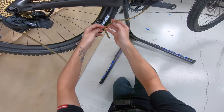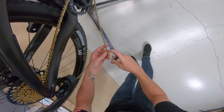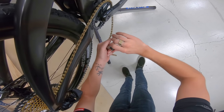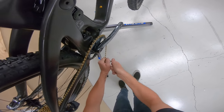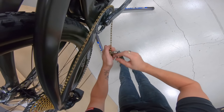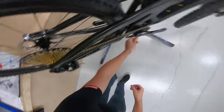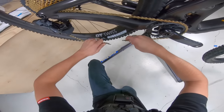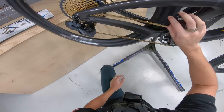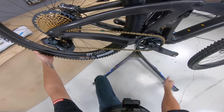That's going to be five outer links to cut. Got my chain breaker and count back those five outer links: one, two, three, four, five. Once we cut those, I'm going to pop my master link back on the correct side. We're going to pull them together and just pull it up to the top so I can pop the chain link together. I do it by holding the back wheel and giving a little slap on the cranks.